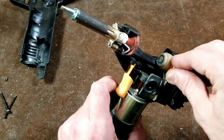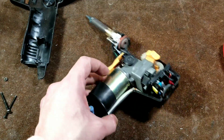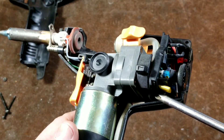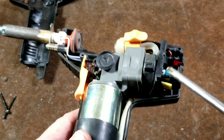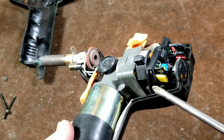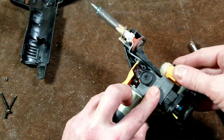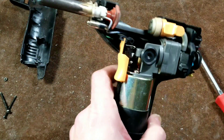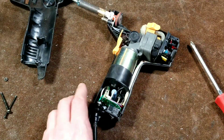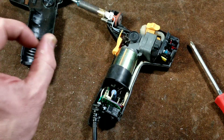There's our little green ground wire actually going up to the metallic portion of the tip, so it is a well-built unit. There's a lot of complicated little parts in this, and so for one of these to be $300 really doesn't seem that bad given all the different things that are involved. They do have a cutout — there's a little flange on the back of this rubberized part that holds this control board, and they have a little cutout for the wires, but they don't fit through, so that doesn't have to be perfect. You just want to make sure that this motor is seated nice and solid in there. I'm going to go ahead and plug it in just so you can see the little crankshaft spin around. You need to be extremely careful whenever you're working on a piece of electronics where you have to have it open in order to do some testing while it's plugged in.